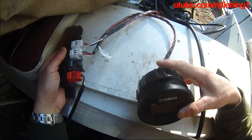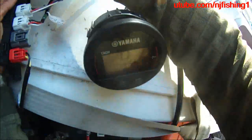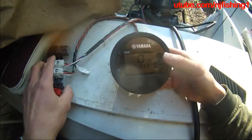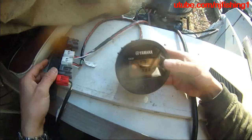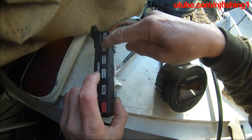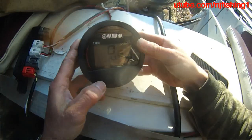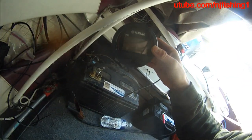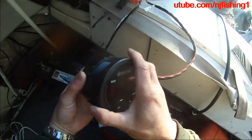This pigtail travels back to the engine, and that's how the system is set up. If I plug in a second terminator, it's not going to do anything — it will still work fine. You really only need one terminator and one command link for one motor. I still have one open device port where I could plug in a tach meter. I'm going to turn the remote control key switch off now — there is the 6Y8 multi-function display, and next I'm going to look at the 6Y4 multi-function display.